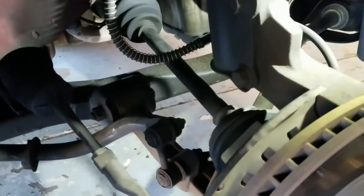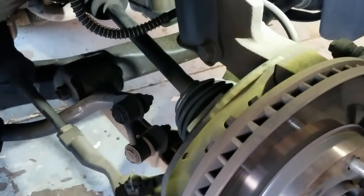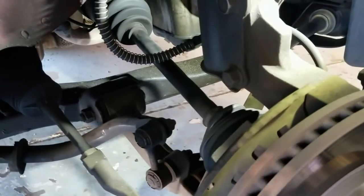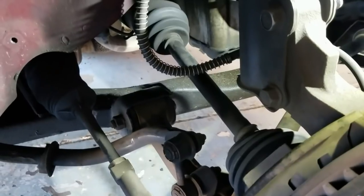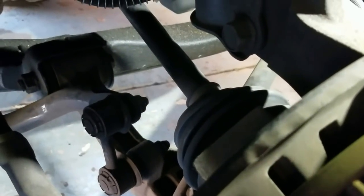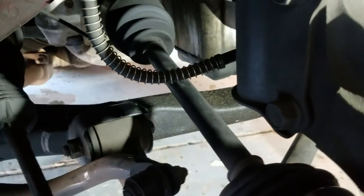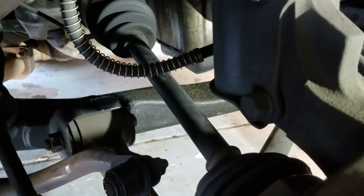It's a little difficult to see here, but I'm turning the rotor, and the hub is turning, and the outside boot is turning, but the CV shaft, the axle, is not turning. So it blew that outer CV apart, or maybe it just broke the axle, even though the boots aren't torn and there are no other signs. Very surprising. Never seen this before as a technician.